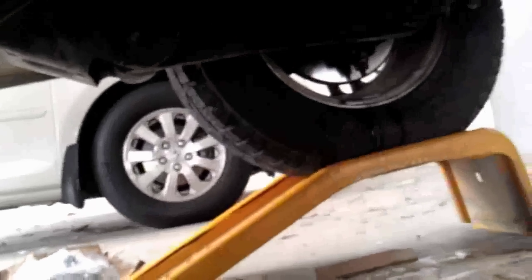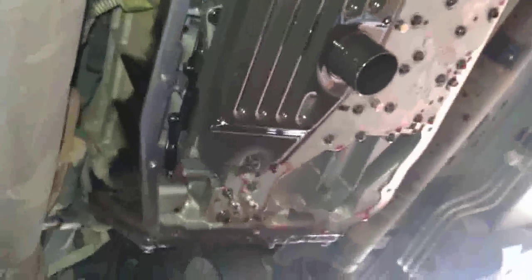This is what it looks like after you get your transmission pan off. I loosened each screw a little bit until I found the first place it started leaking. Had a big catch pan for it — you're going to need something big. This is one of those AutoZone free ones from an oil change that barely fit all of it. Got my Jeep raised up a little bit from the front. This is looking towards the back. It was pretty clean as long as you let it go slowly. So I got the pan out and here's what it looks like inside.